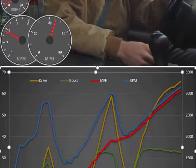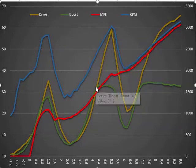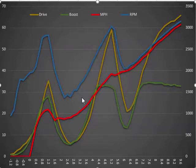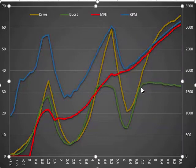Now to the computer. Here we got the 0-60 run. One thing I want to mention is that we disabled the QSV. The reason for that is it really wreaks havoc with the drive pressure. Trying to get a nice clean graph, you wouldn't be able to do that with the QSV on because it would constantly be opening and closing at each shift, making the drive pressure go all over the place, which would mess with the wastegate and ruin our testing of how well the spring gate works. Sticking with the spring gate topic - the main thing is that boost did get to our desired level and there was no overshooting.